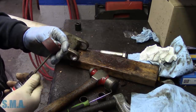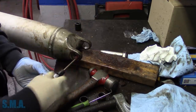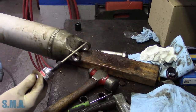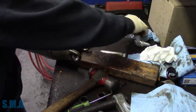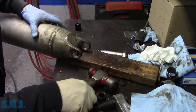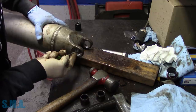Careful, that aluminium disappears very quickly, and you'll have a very loose-fitting U-joint. Good enough. We'll save that. Just a bolt with a slot cut in it. You can put your cloth of the emery in there. Tried to clean out that groove the best I could. It's quite heavily corroded, and the lip of it is almost non-existent.